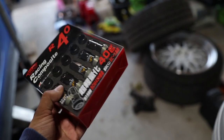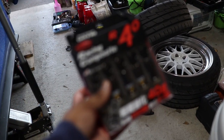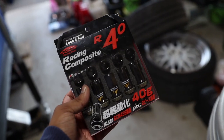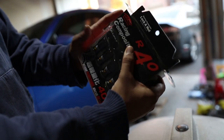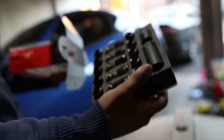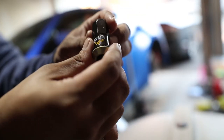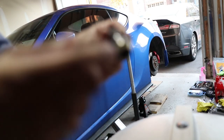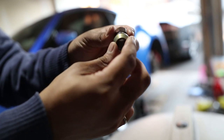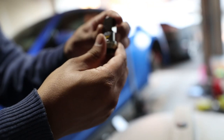To go with the TEs, I picked up these Project Kicks R40 two-piece lug nuts with locking nuts as well. I'll unbox these for you guys and show you what they look like. This is my first set of nice lug nuts. These look so nice and feel really light — high quality. They're two-piece, so there's a washer on the bottom that faces the wheel, so that when you're torquing these down, it doesn't spin against the wheel and you don't scratch up the faces of your wheel.